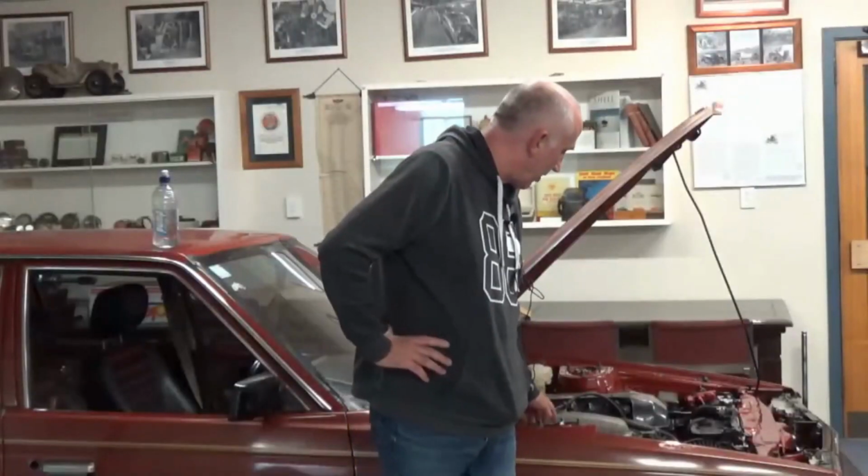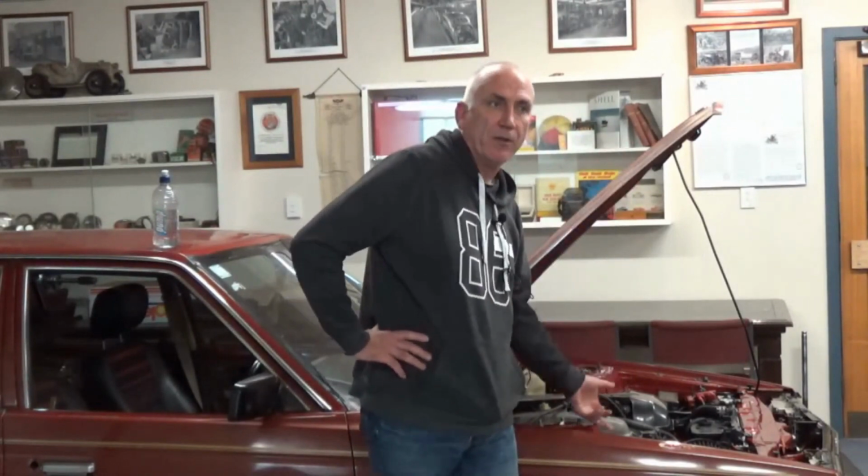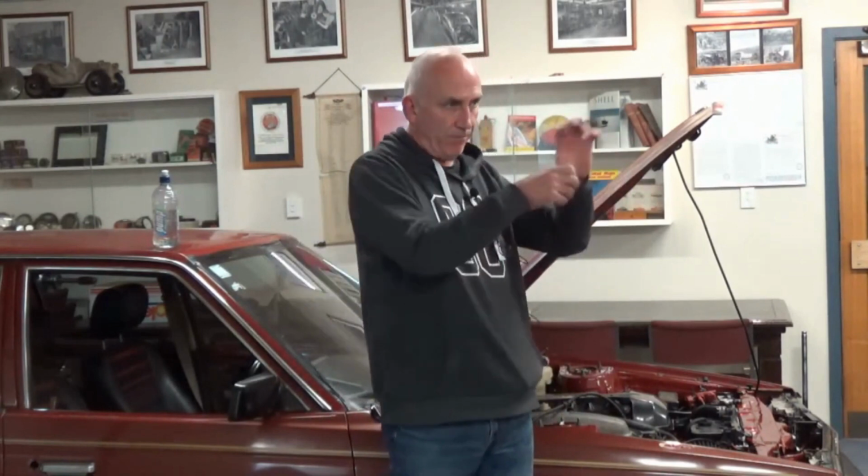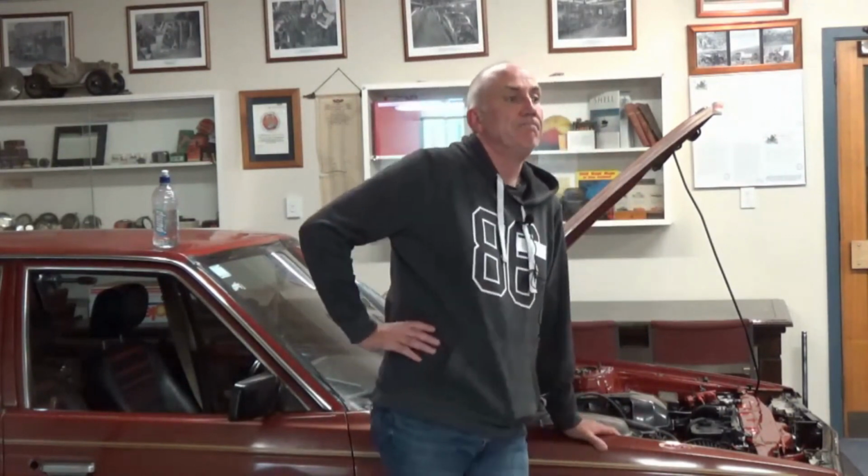So the slip pins are at the top at the moment because the shocks that are in it don't have enough thread engagement to go through the spherical joint. So again, the shocks I'm getting have been modified, so they should fit.